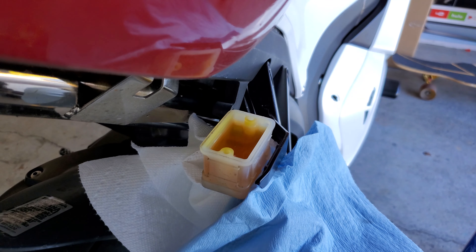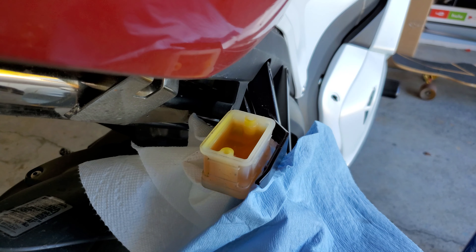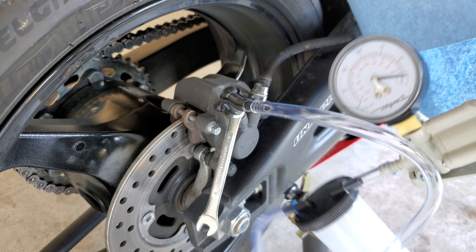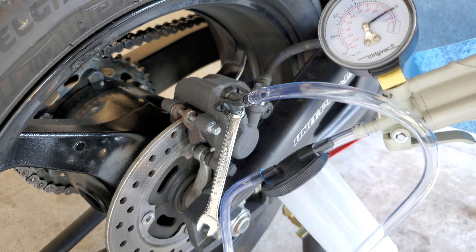Right here I'm poking two different holes in this foil. That way when I pour the brake fluid, it's a lot more controlled and easier to clean up your messes. I got some paper towels stuffed up around here because brake fluid doesn't like any type of finished product — it can start really messing up your finish. So you want to be very careful not to spill any of this stuff, and if you do spill it, clean it up as quickly as you can.